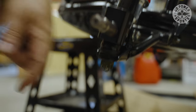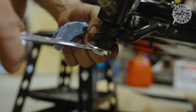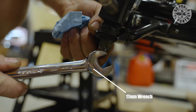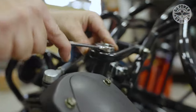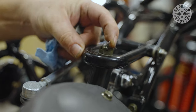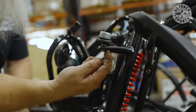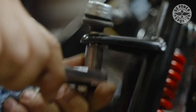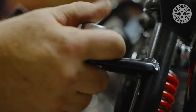Before we put our tires on, we're going to double check our castle nuts are nice and tight on our struts — this is the steering. Without moving the cotter pin that's locking it into place, we're going to make sure it's nice and snug. I'm using a 17 millimeter wrench on this. We also need to check the top, and the tie rod end with a 12 millimeter socket. We got it all nice and tight, ready to go.